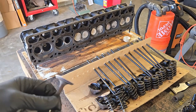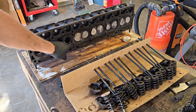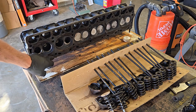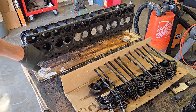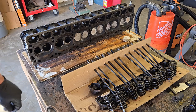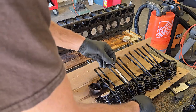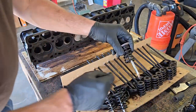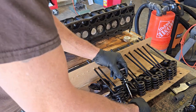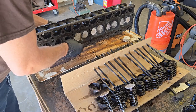and back. And then for the valve seat, if I understand correctly, I think I read one time that the Renix engine does not have a hardened valve seat. I think it's actually the cast iron. I could be wrong. Once I get in that, I'll look a little closer. But for now, let's pull all the valves out, give them a quick look, and put them away with their associated valve spring, all in order, so that I don't get anything kitty-wampus here, because kitties and wampus don't always go together.